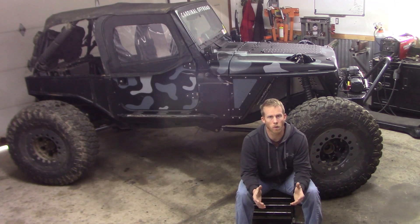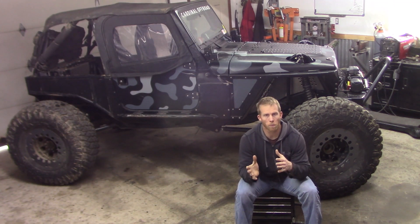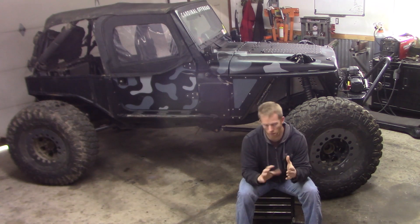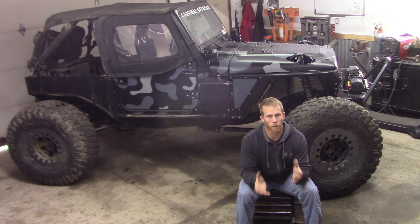The next thing you need to know is size. When you find the radiator you like, look up the dimensions, mock it out of cardboard, stick it in the engine bay, and see what room you have to play with. The width is very important because you do not want it touching the engine — the engine does move with torque — and you don't want it bending or, worse, cracking the radiator.